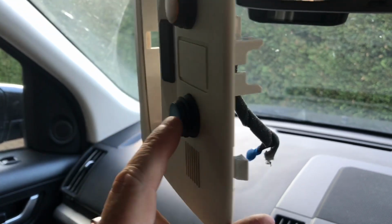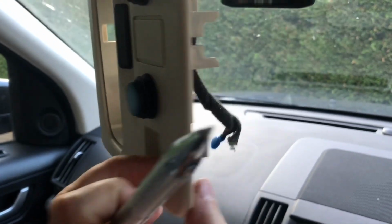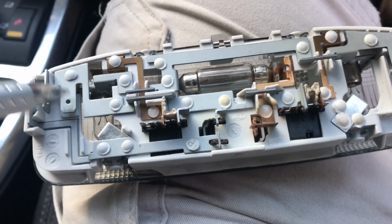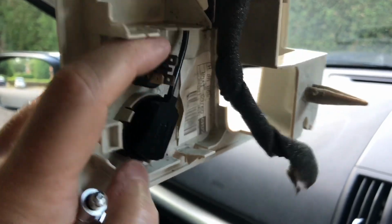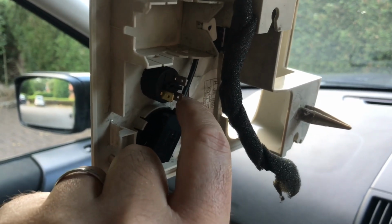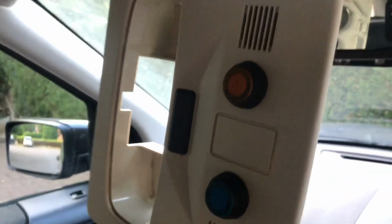Blue here is going to take a feed up from main beam through the button and back down again, so there's no positive needed for that, but I do need to just connect in onto here, ground, purely to get the little LED to light when I press the button. Now the gold connector is the ground connector. That connector there on its own is in, and that is out. Okay, so when the switch is made and that is grounded, the little illumination light comes on to light those up when they're active, which is what I want.